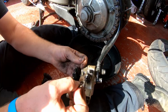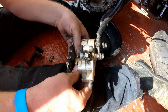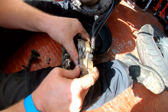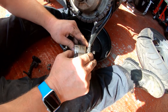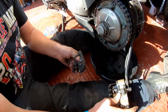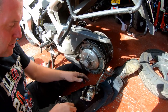The spring plate goes in that way round. As you can see there's a little protrusion on the casting and that little gap goes on like so and clips into place just like that. The pistons aren't sticking out all that far. I'm going to just give them a press in - there we are, they're all good, nice and clean as well. Next, I want to refit the caliper mounting bracket. However, I'm going to grease up the slides with a little bit of red rubber grease.